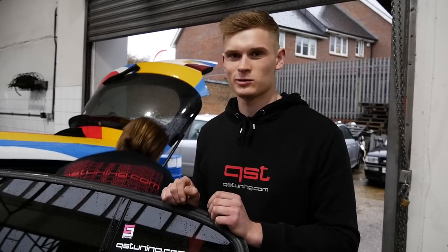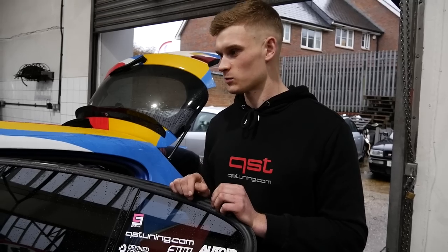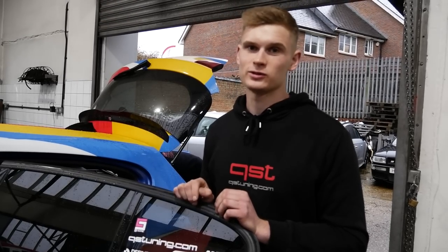If you were going meth dependent, you'd be best to spend more money and get a higher-end kit. But this kit for what we're doing here is absolutely perfect — it's not crazy expensive and it's not super difficult to install either. We're doing it for a bit more octane and a bit more cooling, because intake air temperatures are crazy high on this car on the dyno.